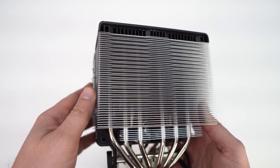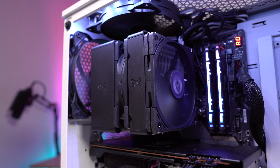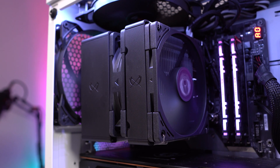Coming to the end here, I really like this cooler from Scythe. It's really impressive what they were able to do from the Fuma 2 to the Fuma 3 — increasing the fin density, making the cooler look a lot better and more modern, and with that increased fin density you're also getting a lot better performance. This cooler in our testing was at the top of the leaderboard, pretty much tied with the Noctua NH-D15 Chromax Black as well as the Cooler Master MasterAir MA624 Stealth. Those are two of the largest and best coolers we've ever tested, and this cooler is actually smaller and performs pretty much the same, which is really awesome.